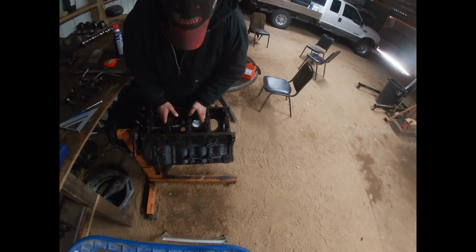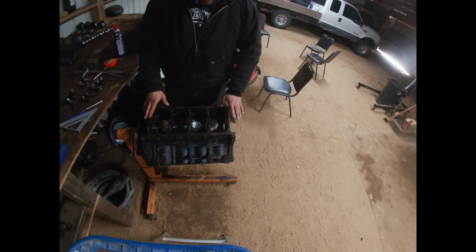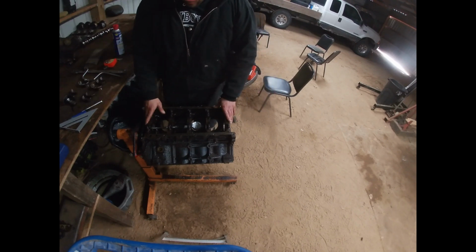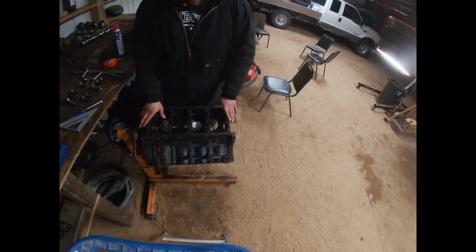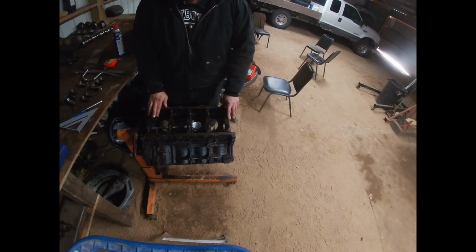And we got just over half of a 10,000th. Now all those are so close, I'm going to call them 2.751, because when you're talking half a 10,000th, this gauge is only accurate to a half thou. So we're going to call that good. They're all solid. The main housing bores are straight. They're not out of round.